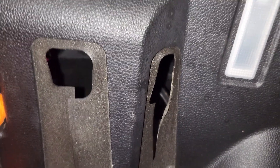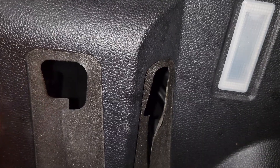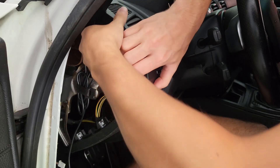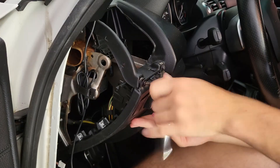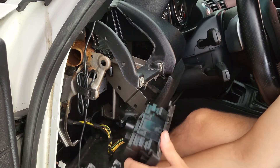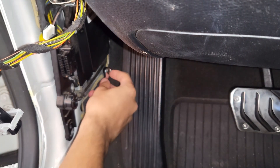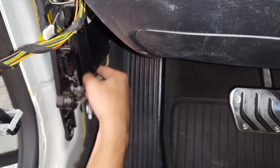On the back here you'll see a cool production detail — that's for the brake pedal, but even if you have an automatic car, they give you this panel with space for a clutch. This may not be strictly necessary, but for the purposes of this video I will be removing this panel here — just slide up and then pull out like that. The FRM doesn't actually bolt in; it just slides out of the bolts on either side. I'm going to remove the bottom one and then simply loosen the top one, because it seems pretty difficult to get out.